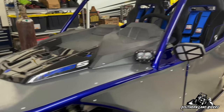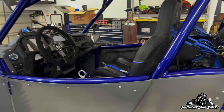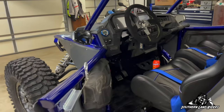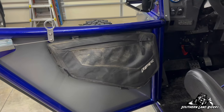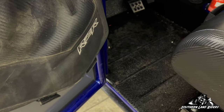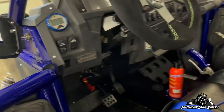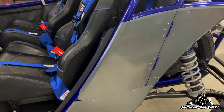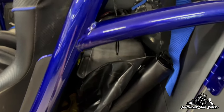I did not like the suicide doors, so I told H I really don't want to climb in and out of this thing like Ryan and Brian do. I'm almost 50 years old — I need to be able to open doors. So he gave me doors that open like a traditional car door. He's also mounted Polaris Razor door bags for additional storage. When he created the floor, it's all heavy-gauge aluminum covered with a bed liner material. I wanted some storage behind the seats, and he delivered — I've got an extended cab tube chassis section that opens up, held in place with a magnet.